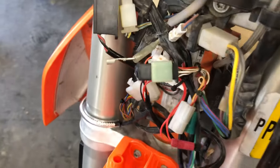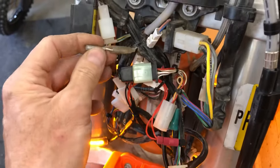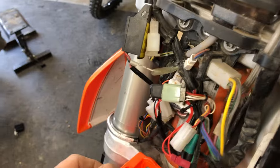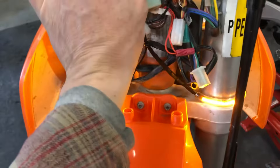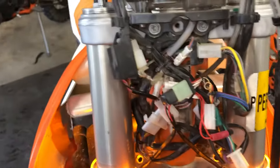I'm going to start this machine up. [bike starts and dies] So if I had that wired into a hidden switch, when the switch is in the on position, the bike will not start — the ignition is disabled. Then when I throw that secret hidden switch, I can now start the bike. [bike starts] And the bike dies when I send that back to ground. If this is connected to ground, the bike won't start — so much more secure than having a key.